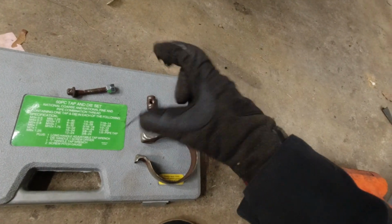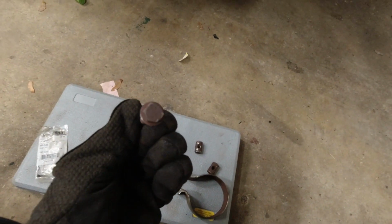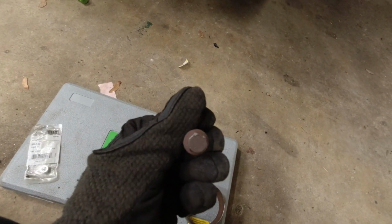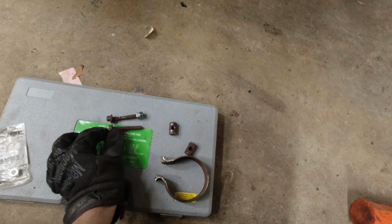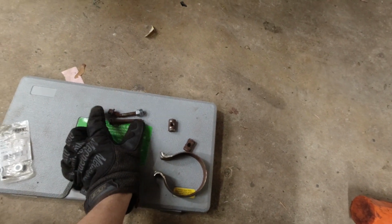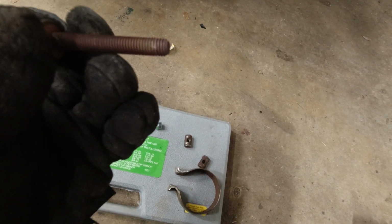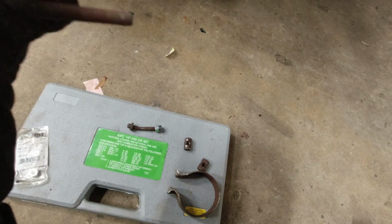I actually found some that were the right length, and I also found that the bolt for the front flange on the exhaust is also M8 by 1.25. So the one that I damaged, being off axis, I'll be replacing as well. I think these are a little bit shorter, like 5 millimeters shorter. So I may take one of the replacements and cut it down just a little bit. Make sure the threads are clean before I put it back in.